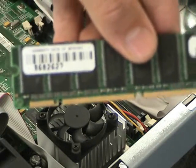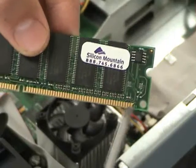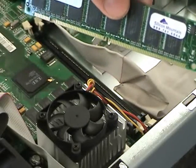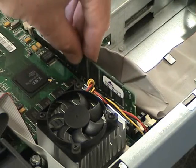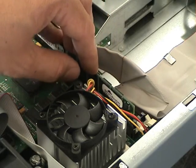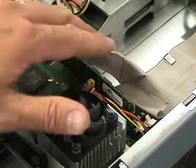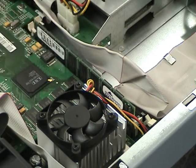You'll notice two notches on the RAM chip. If you line these notches up with the slot where you install the RAM, it'll go in a lot easier — in fact, you can't install RAM incorrectly. On a Prestige there are two memory slots; you want to go in the memory slot closest to the back of the machine. The Avio and the Cron each have only one memory slot. So if you're upgrading from 64 megs to 256 megs, put that in the furthest back slot on the Prestige. The type of memory is SD RAM, and if you've ordered it from us — OD Video — you'll be sure to get the correct type.